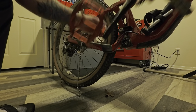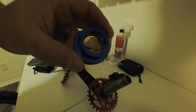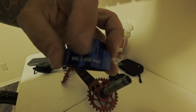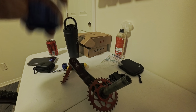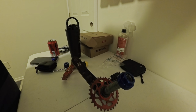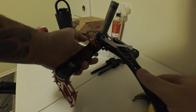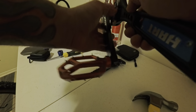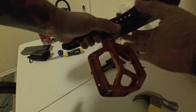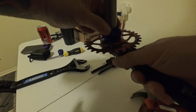Cranks are off. Now, I didn't mention the chainring tool yet — here it is. I got this on Amazon; the link is in the description. It's not an affiliate link but it's hard to find if you don't know what it is. This is how we take the chainring off. It slides down and locks right into the chainring, just like that. A good trick — get it kind of close to the crank for a bit more leverage.